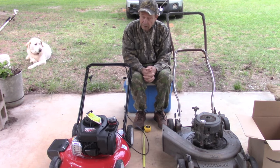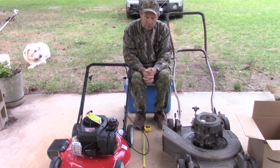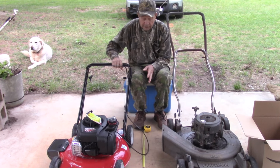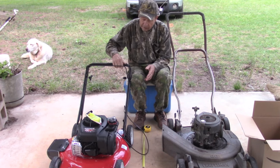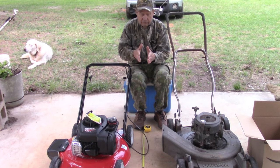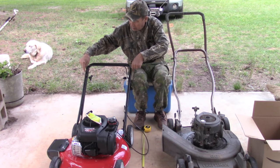Well, what are the options? That's the cheapest engine I can buy. We could take that engine off, then we would have to alter this. There is a problem with the control mechanisms of the newer mowers with this handle bit, which means I would have to modify the grip here and this safety device considerably to fit. In short, I would have to put this on the forge, bend it down like that, then straighten it up again, because there's almost 3 inches difference between this diameter and this diameter.